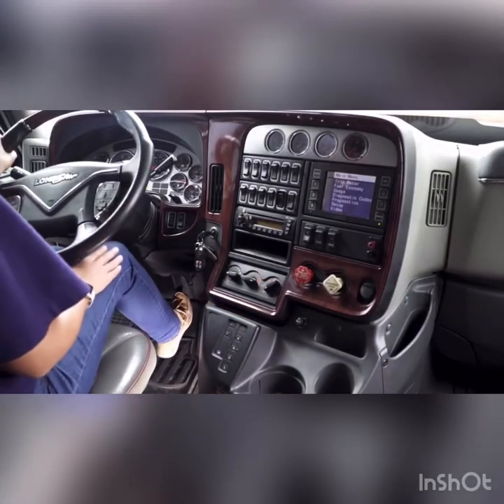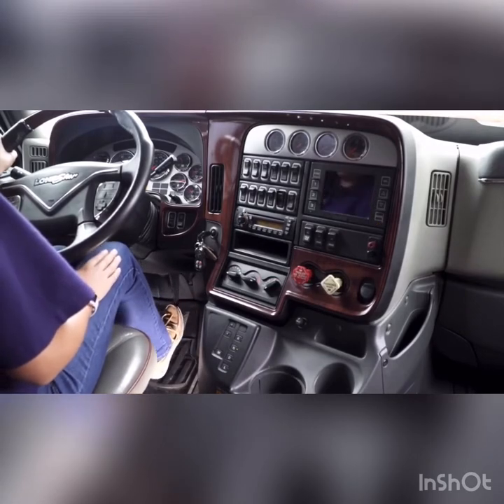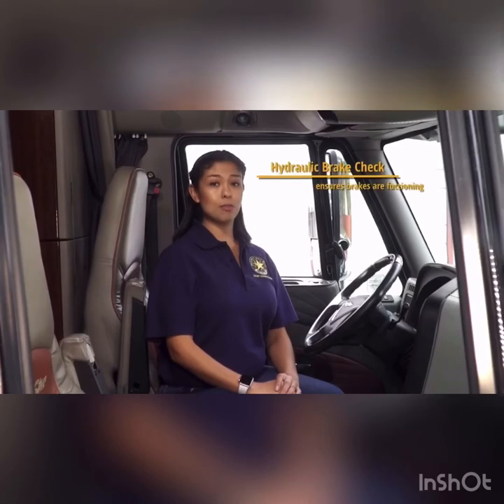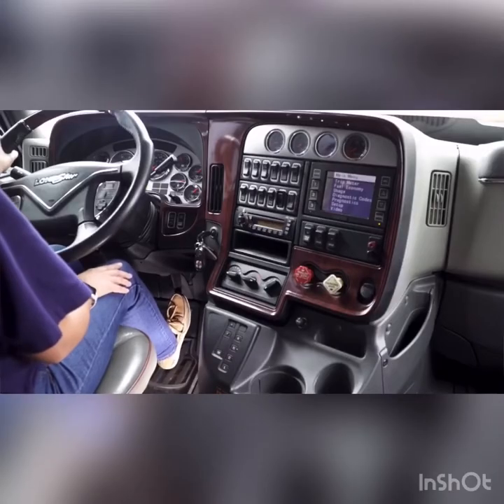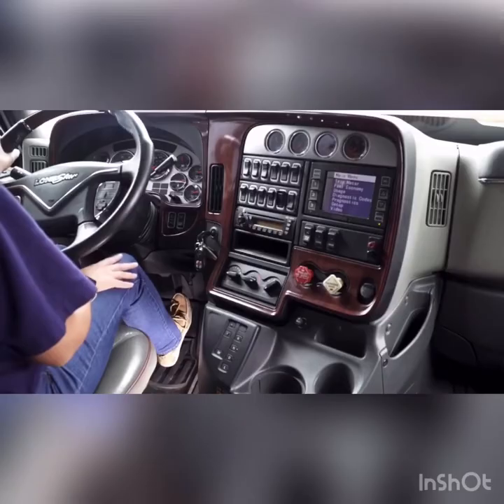I will continue pumping to check my emergency brakes. The trailer and parking brakes will pop out between 20 to 40 psi. I will now perform a hydraulic brake check to ensure the right amount of pressure is applied in case of an emergency. I am going to pump my brake pedal three times and hold it for five seconds, observing that my pedal doesn't fade.